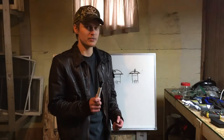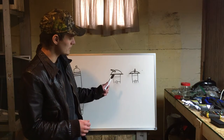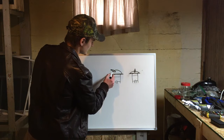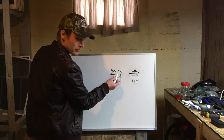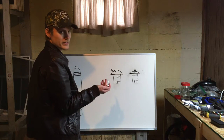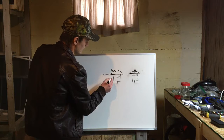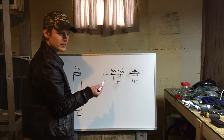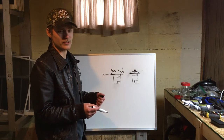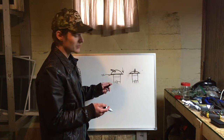You may have noticed me mention earlier that you do not want to remove the head gasket in this situation. However, some people do to try to get some more compression. I have this illustrated here — this is a standard head, this is a high compression head, illustrating the dome. Some people that maybe don't want to spring for the 65 or $70 for the high compression head will remove the head gasket, which lowers the head another millimeter or two and supposedly gives a little more performance. Honestly, I'm not really a fan of that because whenever you remove a gasket, it's possible for the metal to fuse under extreme heat and pressure.